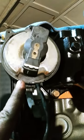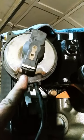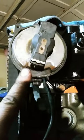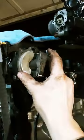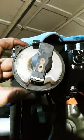When trying to get top dead center, if you're trying to put this all together, that's where you want your rotor. On the distributor, think of this like a dial — for top dead center, advanced, retarded — this is where it's going to want to sit. This is actually indented here; you want it right in here on this side, on the front side of the notch, and you want it as centered as possible. From here, once it's set, you can adjust it to get the proper ignition timing.